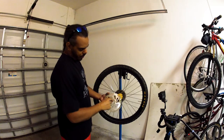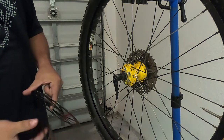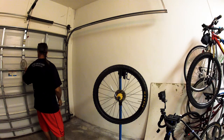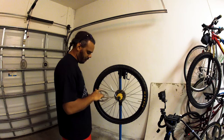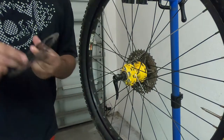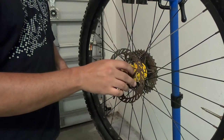So like I said, we are going from 180 back down to 160. It's a pretty big jump, but this is going on the rear, so heat dissipation is a little bit less of a concern. Make sure when you put these on, directional rotation is usually printed on the rotor — there's a nice little arrow here, and it's usually facing out. Slide that on there.